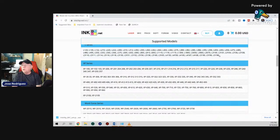If you're really good, you can possibly access that tube that I told you about that actually delivers the waste ink to the internal pads and then migrate it to the outside. I figure even if I have to drill a little hole on the side panel so I can pull that tubing through it, it's worth it, because after a couple of resets, that would have cost me, say, $300, $400 worth of repairs. Not repairs, but, you know, servicing. I think it's well worth it.